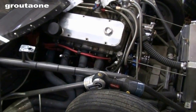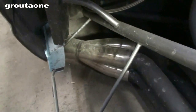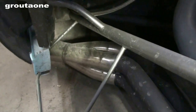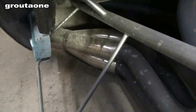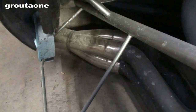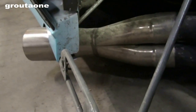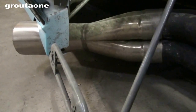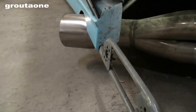I was also going to show you the collectors that are on my race car. You can see here where the weld is right here — it actually gets smaller right there. So you can imagine if a collector helps to make power, then if your collector is efficient it's going to make even more power. This collector is thin there, it develops more air speed and helps to extract more from the ones that haven't fired yet. I'll show you the inside of this collector also.